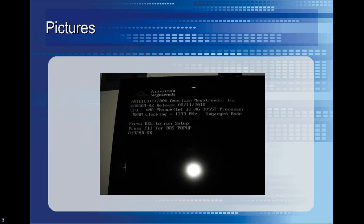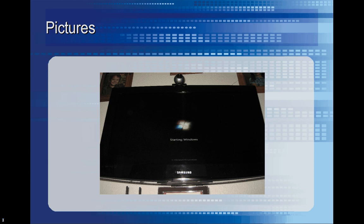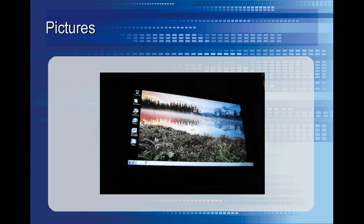The computer is registering all the RAM. I went into BIOS and switched over the graphics settings — I turned off the internal graphics, set it to look for the PCIe slot, and also set it to boot from my thumb drive and installed my operating system. After I got the OS up and going, I went ahead and installed the software I needed to get the computer to do what I needed it to do.